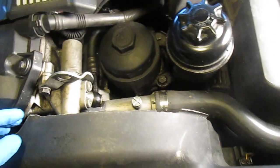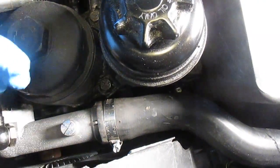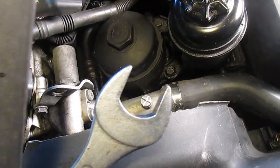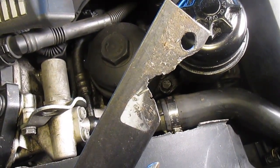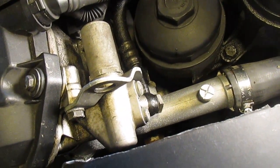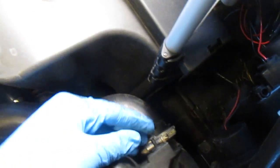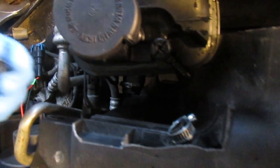The first thing I'm going to do is remove the fan and the fan shroud. I've already loosened the fan nut — I used tool 832 and made a tool to hold the water pump pulley. You've got to find some way to loosen that nut. There are two tabs — one here and one here — that need to come out.